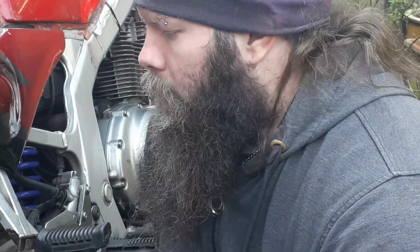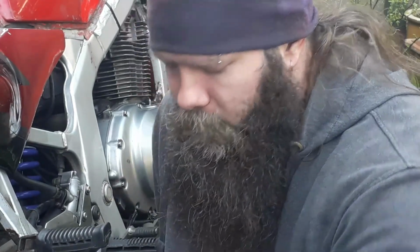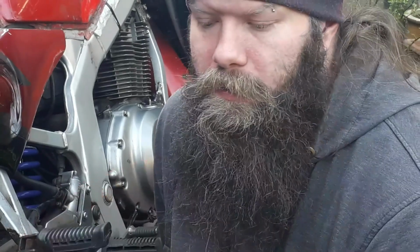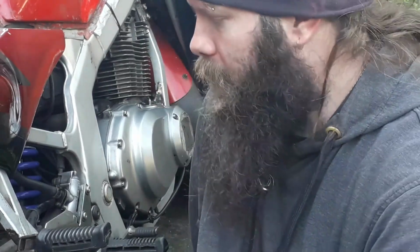Where I've done that now, the last thing to do really is to put fluid in the system. I think there might be a little bit of fluid there, but I've got a feeling it's going to be old fluid. So I've got some Dot 4 brake and clutch fluid. Not sponsored or anything like that, but that's what I'm going to use. So the one thing we've got to do is put that into all of it.